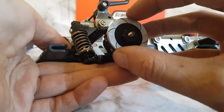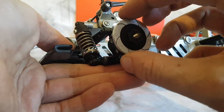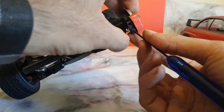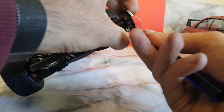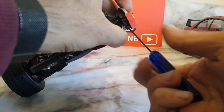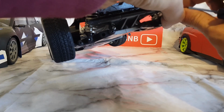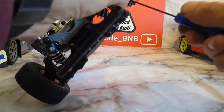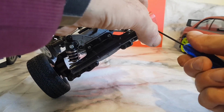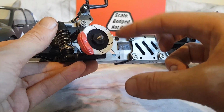And the brake disc simply fits over. I have got the recesses in the back for the pin. That slots in place. Then use the supplied screws to fit the caliper to the hub. There we go, static caliper with a movable disc.